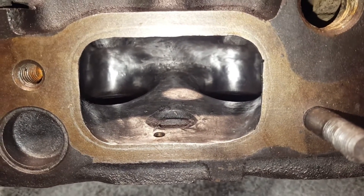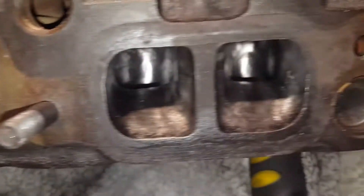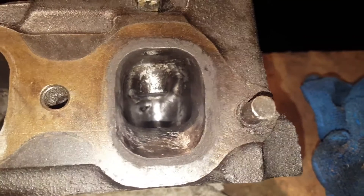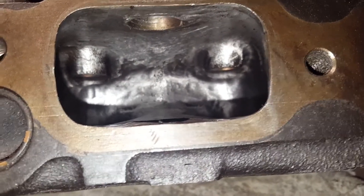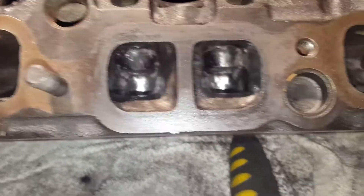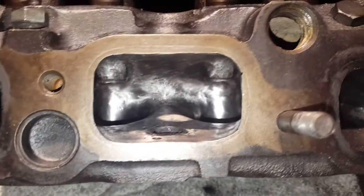The areas with the hole at the bottom of the port — that's where the lump sits — so not a big deal; I didn't spend a ton of time on those spots. They look a little rougher and not quite as shiny as the other parts of the port. I also found that the valve guide boss hanging down there was pretty tricky with the Dremel, because I didn't really have the appropriate bit for it. The carbide bit just chopped away at it — fine to get some carbon off, but not a smooth job. Either way, it's still way better than it was. All the side ridge lines are gone.